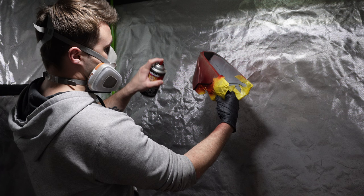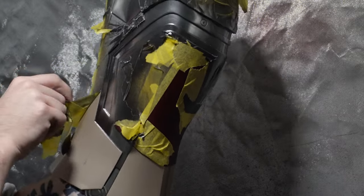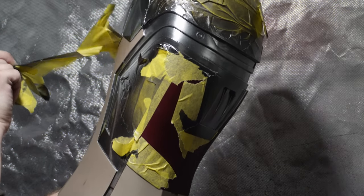Once I painted all the red areas, I removed the masking tape and paper and let it sit for about a day - just to be absolutely sure the paint was dry before moving on. Then I masked off all the areas I wanted to paint chrome, painted them flat black, added a gloss clear coat over that, and then finally added the Duralumin Tuff for that chrome finish. Again, I removed all the masking tape, let that sit, and then drenched everything in 2K clear coat. Usually I stick to Duplicolor 1K because of its long pot life in the can, but since I had so many parts I went with the SprayMax 2K clear coat. The SprayMax 2K is only meant to last about two days once you've activated both parts, but since I had so many parts the 2K was not going to go to waste.